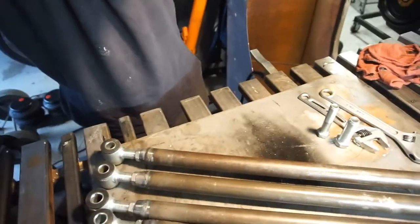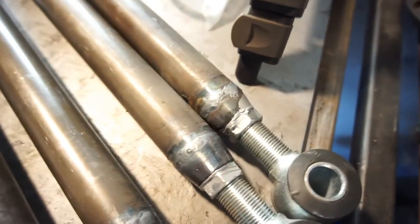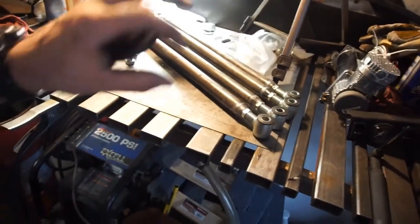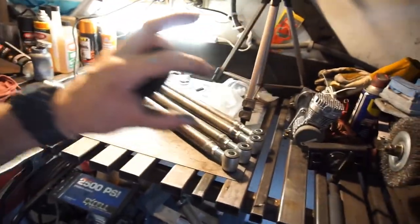That's pretty much it — get it off the tripod. The welds will be a lot better now, there's just a lot of anti-seize but whatever. Anyway, that's going to be it for this video — this is just me assembling the parallel arms. It's called the equal-length parallel four-link, so the top and bottom arms are supposed to be the same length, and now they are.